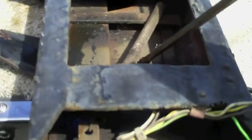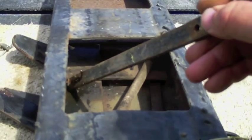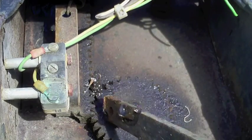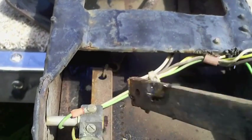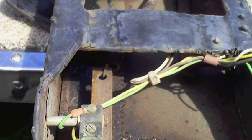You want to look at all this and make sure your springs are tight. Do not run it if you need new springs — they're cheap. Don't get them at the camper store, get them at the hardware store. I would recommend a blob of grease right here, a blob of grease down here on the actual teeth, and then some grease back here behind the bar. Just a few drops of grease took my hitch from being kind of a sticky pain to working flawlessly again.